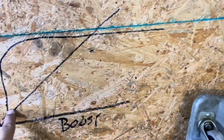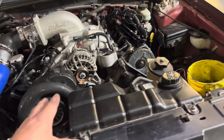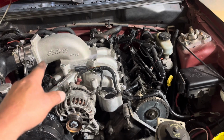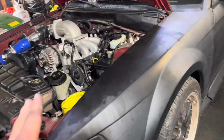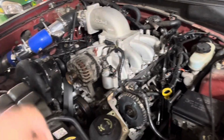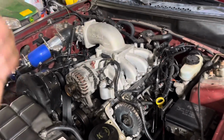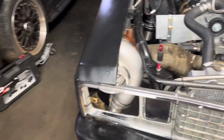So, supercharger, it's a centrifugal, not a Roots, not a Lysholm, not a Whipple, and this is the turbo. All turbos are different, different back housing, all kinds of different things. That's why we're openly mocking this thing, talking about how it's going to knock the bottom end out of it. They put a single plane intake on it, which took all the torque those little 281 cubic inch engines didn't have, and they said they're going to replace it with this. The problem is this thing wasn't going to make any power until up in the RPM range. So this car is literally going to be a gutless wonder. The owner knows it, and they're fine with it. As long as they're fine with it, I'm fine with it. Just thought I'd explain why you would see a single runner intake on a Procharger vehicle. They had a theory, their theory is wrong, but we get paid to put it in no matter what the theory is, so there it is. Turbos can come in quicker and maintain that flat. Turbo is always better.